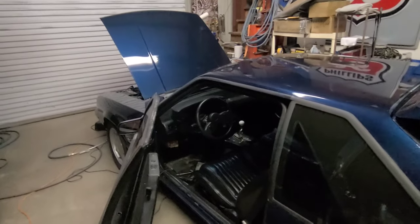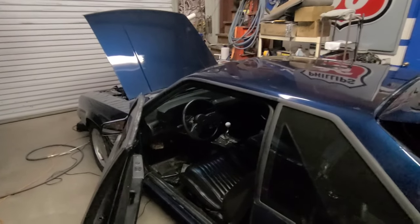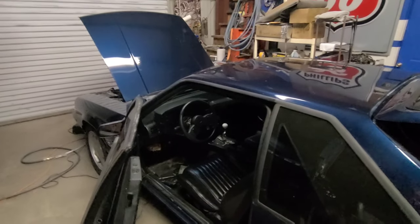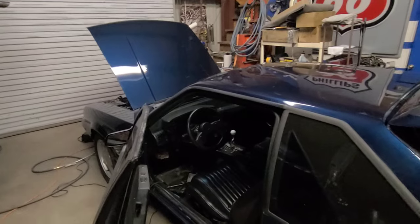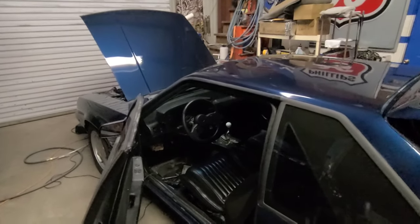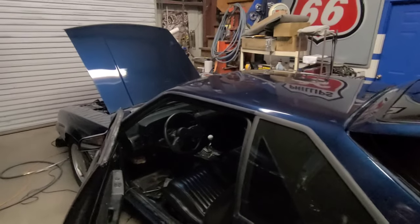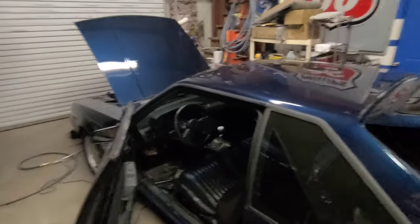So typically it has a break in it somewhere and it's not connected. And that will blow only out of the defrost and you will have no controls with it anywhere else. So sure enough, I turn it on and I've got defrost only. So now I'm extra mad because I've already chased this down. I already fixed that vacuum leak. I couldn't understand for the life of me what had happened. Had I gotten aggressive? Did I disconnect in the dashboard? And I went through it all.